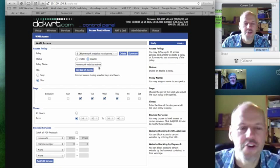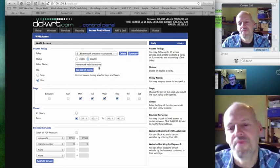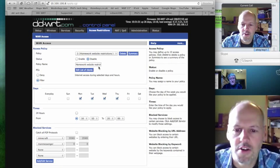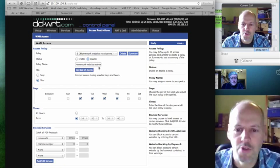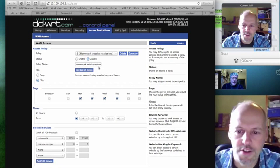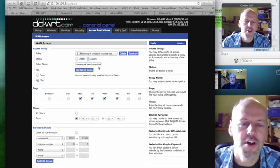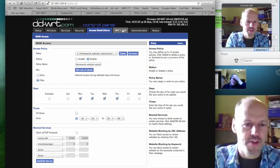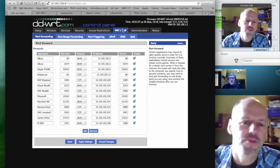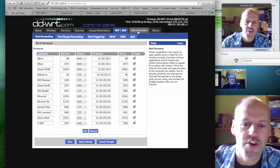Only just experimenting for myself, really. I've got to the stage where I can make sure my DD-WRT router is actually spreading some Wi-Fi, and it's all accessible and works freely. I've just swapped around my SSIDs so that the inner router assumes the personality of the outer, previously the only router. So I'm making it transparent, although it'll need the passwords putting in one more time on people's devices. But I'm keeping the SSID the same and swapping over the functions of my two routers now.